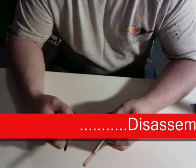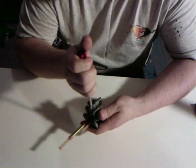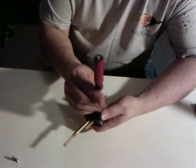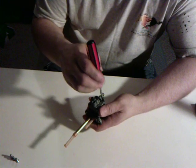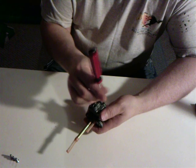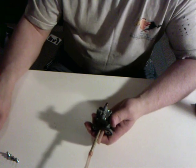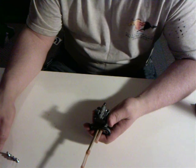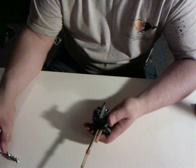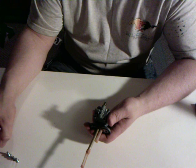To begin disassembly, take an appropriately sized Phillips screwdriver and begin slowly removing the screws. You want to make sure that these are all the proper screws. On a used bike, you can end up with screws that are the wrong size, the wrong length, the wrong thread — because even though these are metric, you do have metric coarse, fine, and extra fine thread.